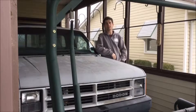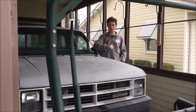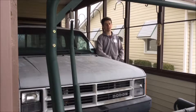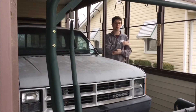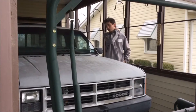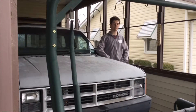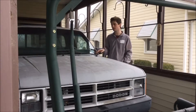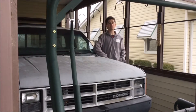So that is the end of today's video. I just parked the thing back on my grandmother's porch right now, and it's running really good. I have no complaints — this thing runs really well, and no overheating problems anymore. So that was the problem: the antifreeze was bad, and the radiator also needed to be cleaned out. Regardless, I still think it was a good idea to put fresh antifreeze in it, so this thing is good to go. As always, please consider subscribing — we'll keep you updated on more videos.